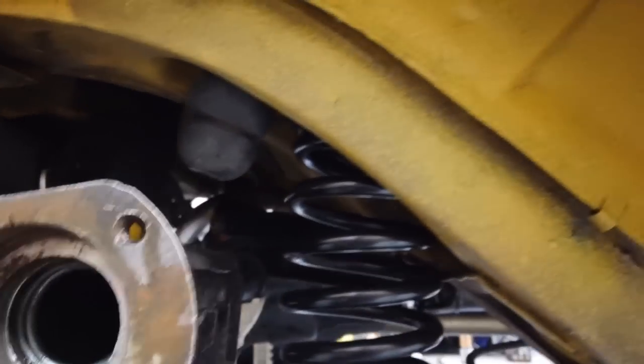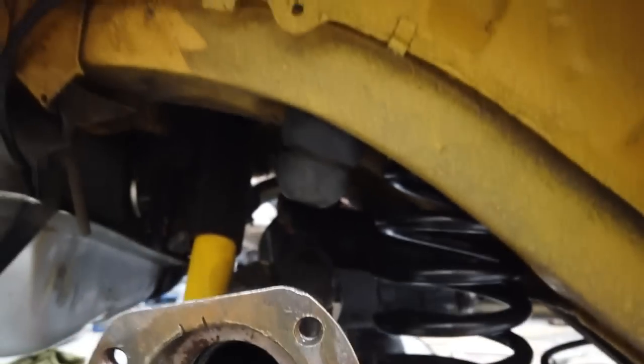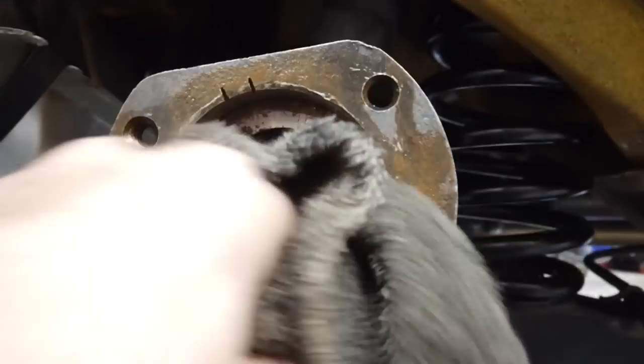That meant I'd like about five degrees pointing up on the nose of the pinion of the back axle, which it is. You can go a little bit more. Now, just some emery paper on the inside of the end of the axle where the wheel bearings go, cleaning up. And then the backing plate back on.